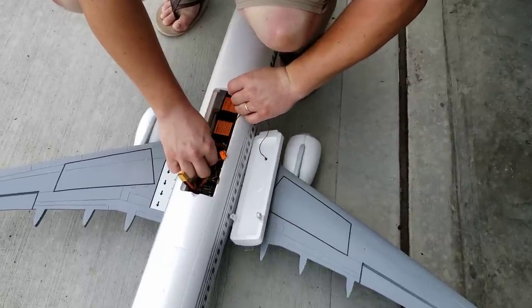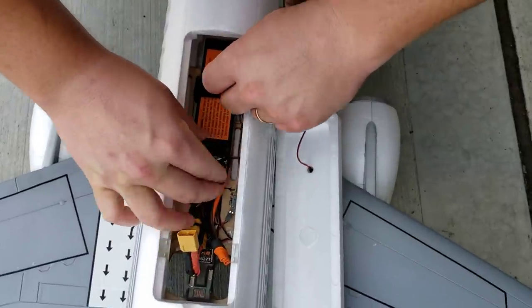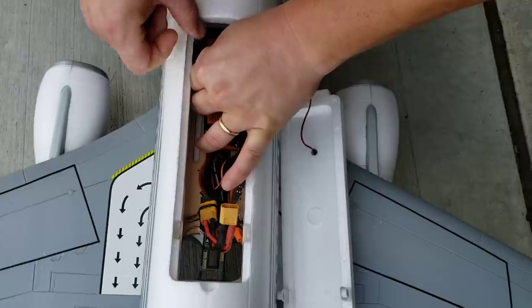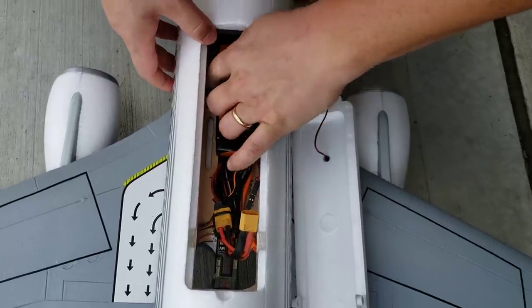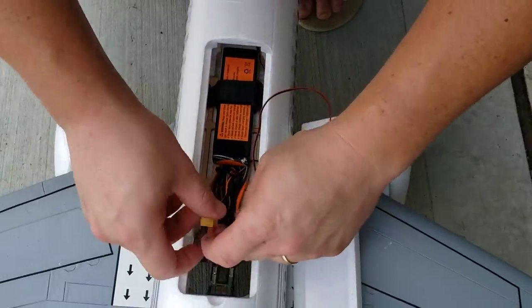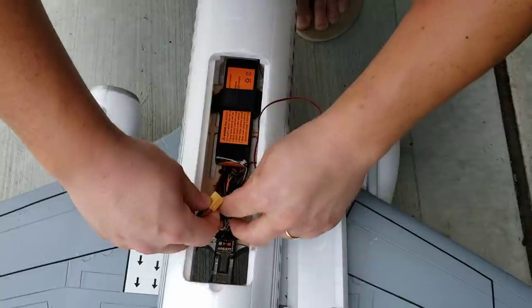So I'm going to go kind of in the middle of these two packs. You see I've got the markings there, hon, can they see? Mm-hmm. So I'm just going to pull this in tight as though I've got it right, and then we'll test it for CG. CG bumps are here and here. So we're just listening for beeping, alarming.